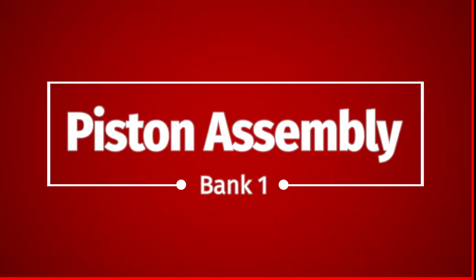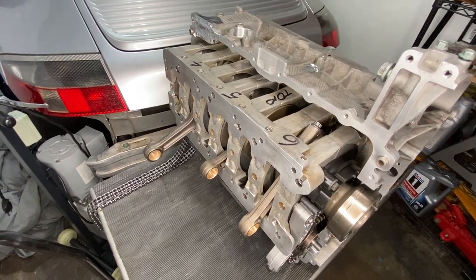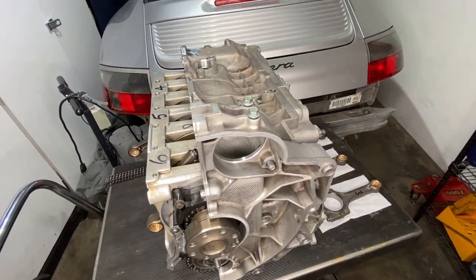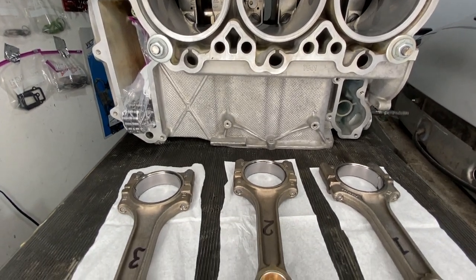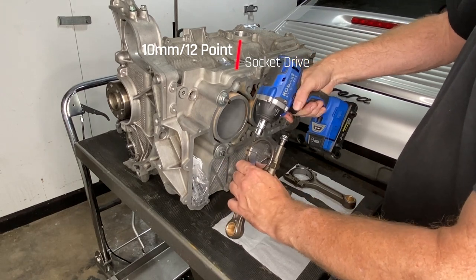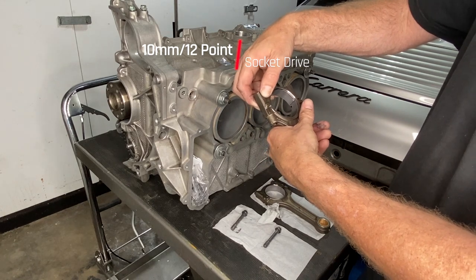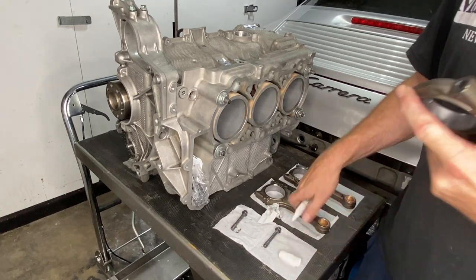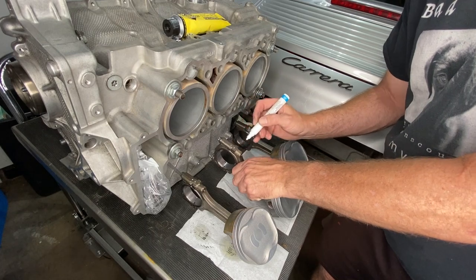Oh no. Piston assembly. That means wrist pin circlips. You can see here that the bank two side is just kind of dangling. These are the con rods, pretty much how they came back from the machine shop. We do have to take off the ARP con rod bolts once again. Just checking that the caps are the right way around, and then I'm marking those with those fancy Sharpie markers that subscriber David Gray sent last week. Thank you, David.